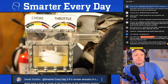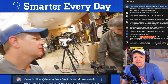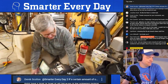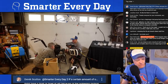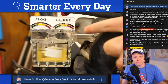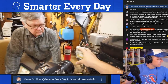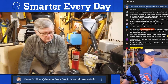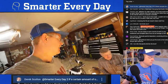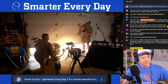Flow of fuel into the bowl so you always have the right amount. Now, backfiring is an issue. It is an issue, and how about getting this ready to go? Yeah, because we spilled some gasoline a few minutes ago. If a backfire happens, fire is going to come backwards into the carburetor, and we did not pressure test this carburetor. So this could explode, and all this gas could be on fire and go around us. Hopefully not. As a matter of fact, open the door just a little bit, let whatever vapors here on the floor go out. Okay. Ready?